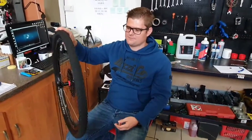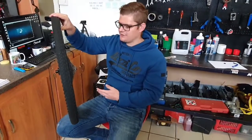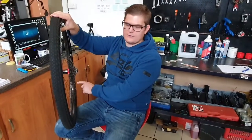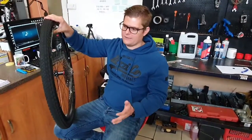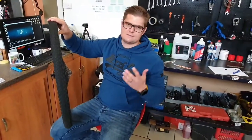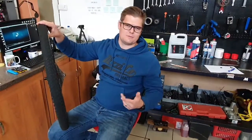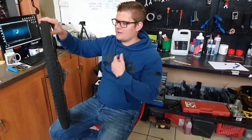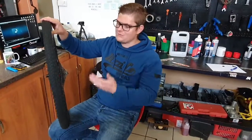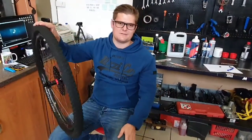We'll use the hand pump and inflate to 2 bar, otherwise use a compressor, and check for leaks. If it's leaking out through the valve, don't grab pliers — tighten with your hands only. If you've got leakage through the nipple holes, you've damaged your rim tape or it wasn't put on correctly. To summarize: clean the rim, put down insulation or electric tape first, then two layers of duct tape or tubeless tape. That works very well as a cheap alternative for making your wheels tubeless.